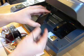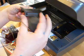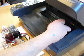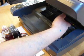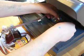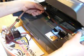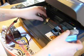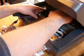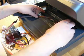You do need to be careful when you do this. We've removed the cover — we're going to put that to one side and it can be put back on if you ever need to. The next thing is to slide the cartridge block to the left-hand side, then with the continuous ink system cartridges we're going to put it underneath the T-bar and place it down on the right-hand side. Make sure you've got a nice straight line with no bends or twists, otherwise that's going to cause problems later on. Then manually slide the cartridge block back to the right and insert the cartridges.